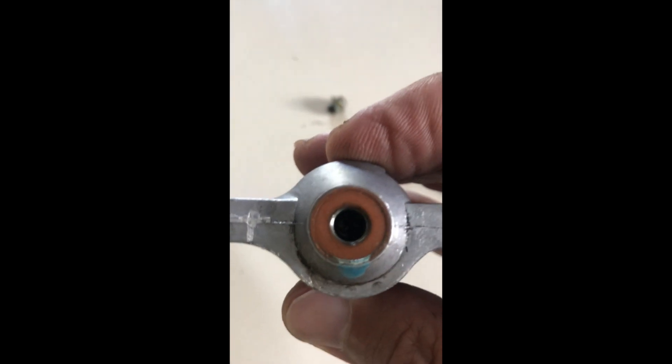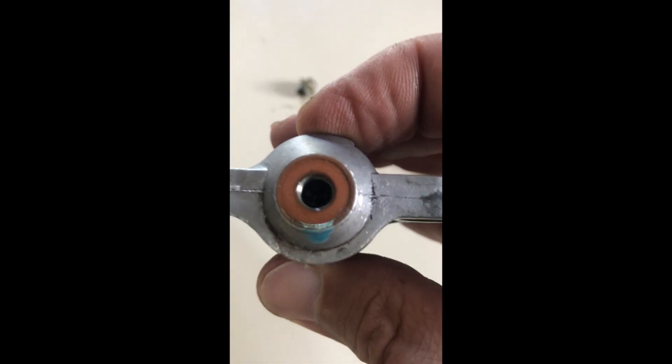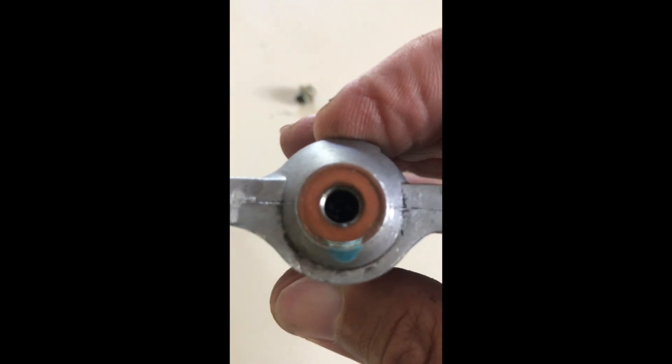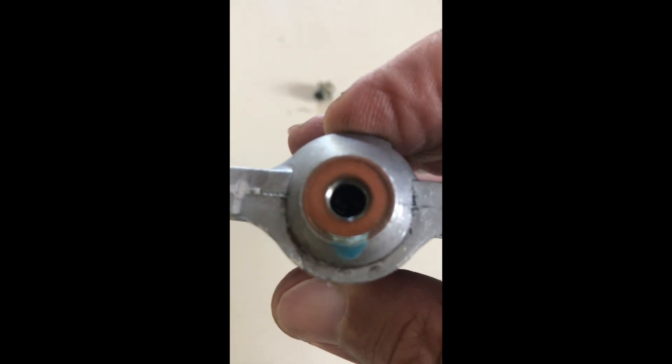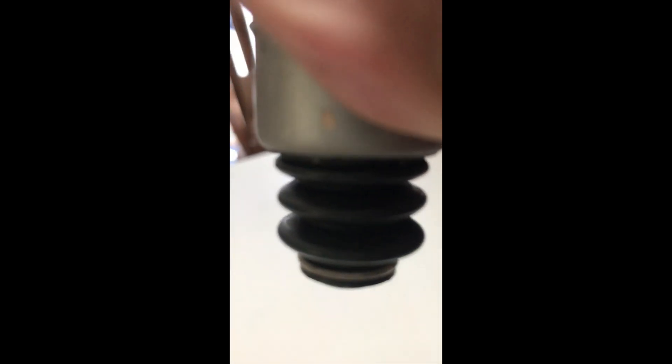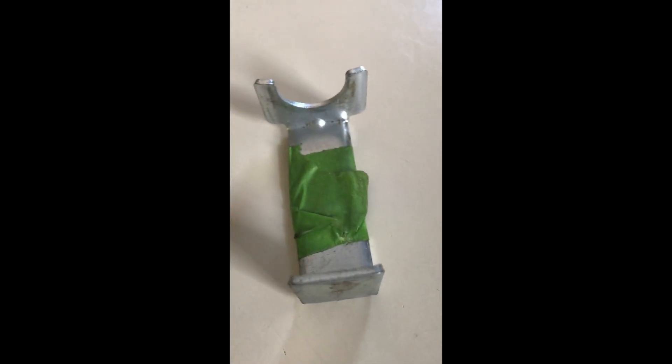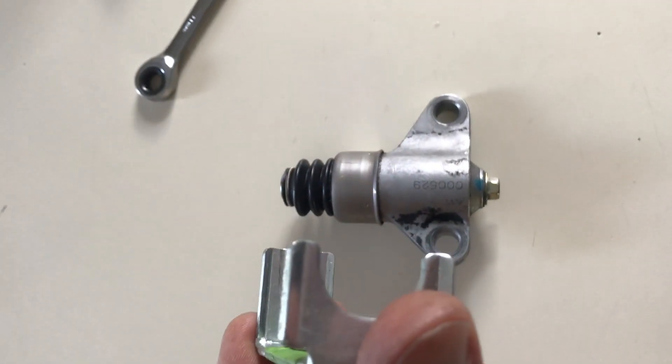Taking that out — that's where the oil is. There is also a flat head threaded rod in there that we're going to use to turn, and what that will do is retract the piston back in. Then we're going to simultaneously put that keeper over the top, so I'm going to need two hands for this and have someone else hold my camera.